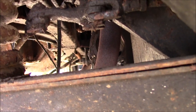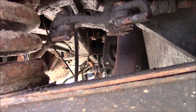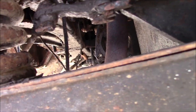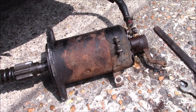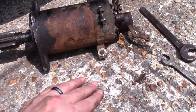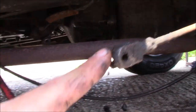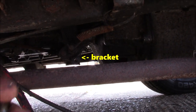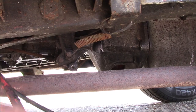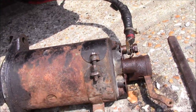When you go in from the front of the car, which is where I am at the moment, just underneath the bumper, there is a bolt on the end of the starter motor which is for the main cable, and it was stuck, so we couldn't undo it. I'd been told that you have to remove the exhaust to take it off. Now we haven't removed the exhaust and we've managed to get the starter motor off, so clearly there's an alternative way, which is to disconnect - I think this is the brake rod. That's held in, it attaches to a bracket up there which has a clevis pin and a little split pin. So I knock the split pin out, remove the clevis pin, move the brake rod out of the way, and then that allows you to get the starter motor out.